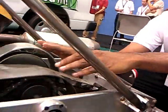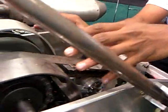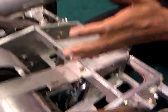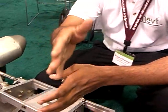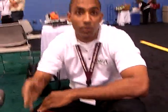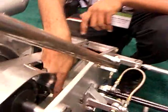The reason for the CVTs is that this now gives us the option of disengaging one of the two drives. So this gives us the option of driving it as a parallel, where you have the gas engine and the electric motor both providing propulsion power, or we can disengage it so that it's electric only, or gas only, or with electric where the gas engine is running to charge up our batteries. We also have our generator down here — this black casing right down here — which is what the engine runs so that our batteries are charged and we keep a constant state of charge.